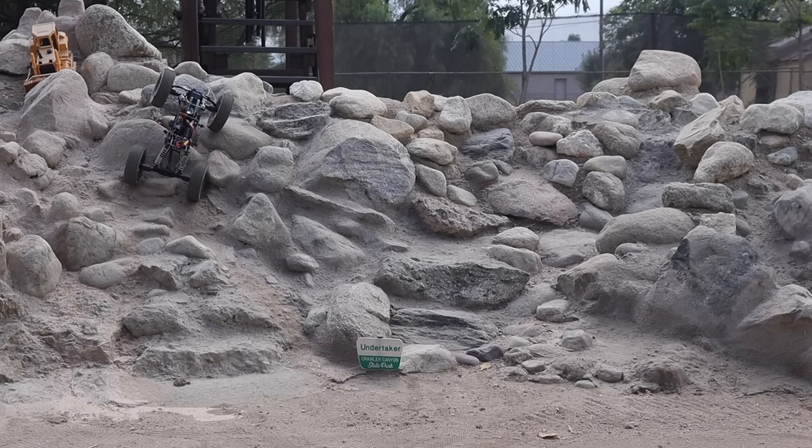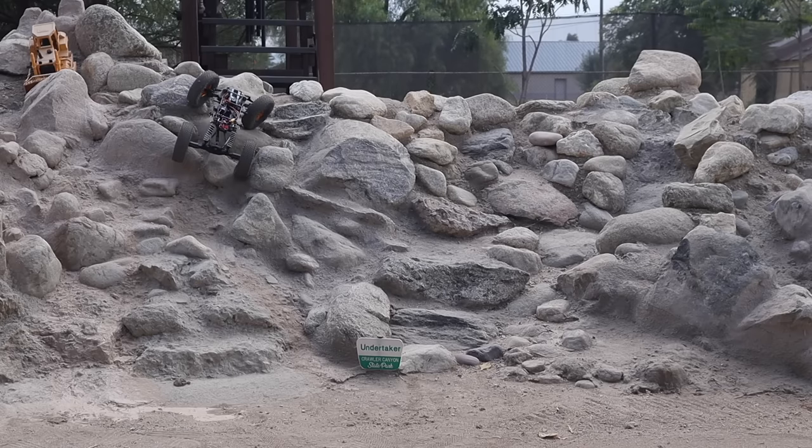Yeah, see, right? When you dig the front end, they operate independently. And the way the linkage works, like I said, there's a spring on either side of the gear. If there was enough room, you could dig the front. So you could stop the front and power the rear. But there's no room for the linkage to move, not where the servo is mounted. So it could have front dig and rear dig, but they designed it in such a way that you can't fit a linkage in there to make it happen.